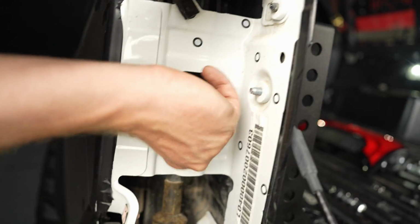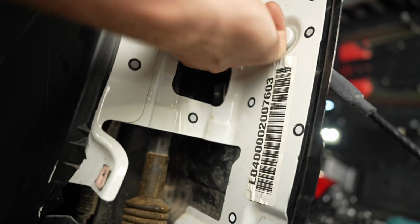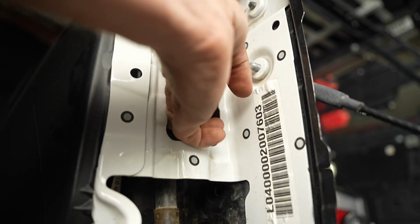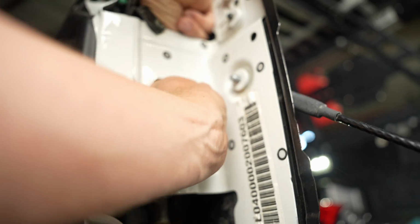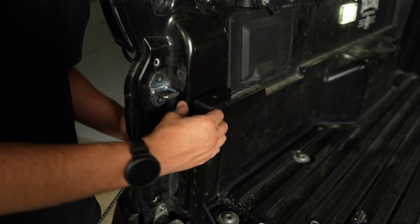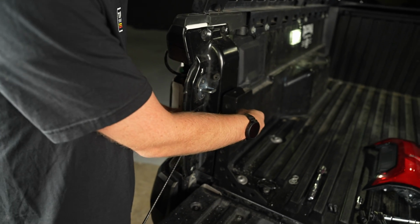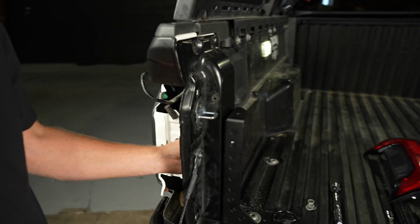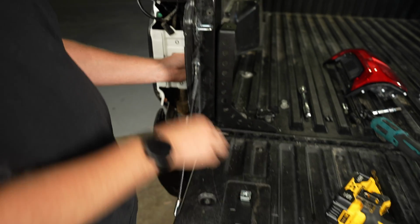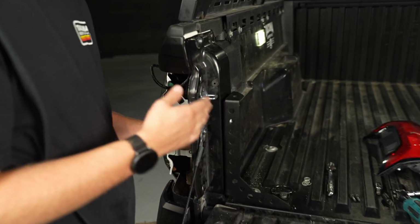I'm gonna take it up in here. Now put it into the hole. See if I can work it in there without dropping it. All right, so as I said before, we put this bolt in to not only hold the bed stiffener in place, but by it being in there, we can already be putting this bracket, which I'm holding up right now, inside, and it can just lay over the bolt so you know where it needs to go.